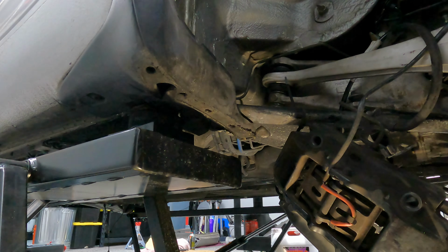All right, this is the tough one because the nut for this is right in here, and a standard width wrench won't fit too well in here. It's too fat. So you may need one of these here. As you can see, the thickness difference is significant enough to where I can get this wrench in here, no problem, locked into place. So when I torque, I can get 133 foot-pounds of torque on that bolt. Okay, 133. Whew, that was not fun.